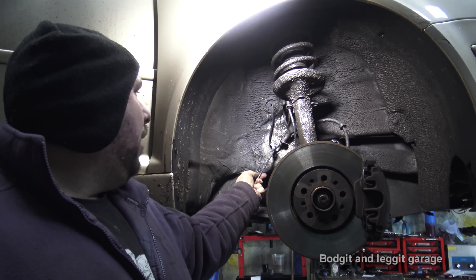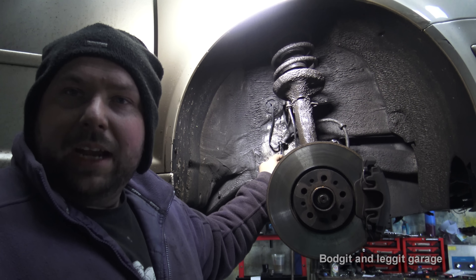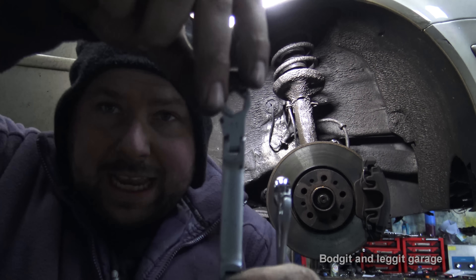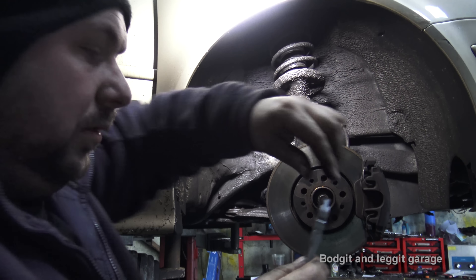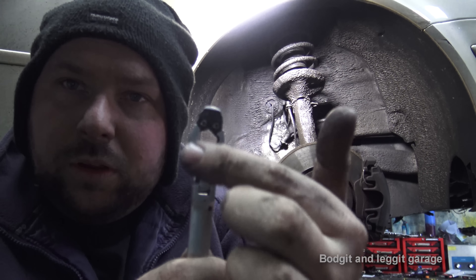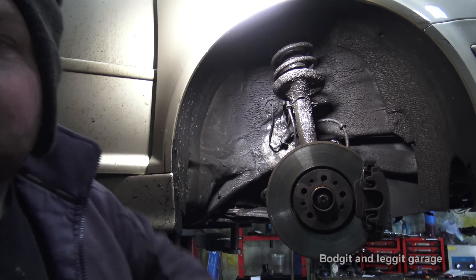As you can see the difference — they're more closed. This little gap allows you to put it onto the actual brake line and get a better grip around the nut. Or you can use this, which is my favourite. This one opens up so you can slide the brake line in, then it closes so you've got a full spanner around it, which gives you the best chance. If this doesn't work, you're screwed — you'd have to cut it off or replace the line.